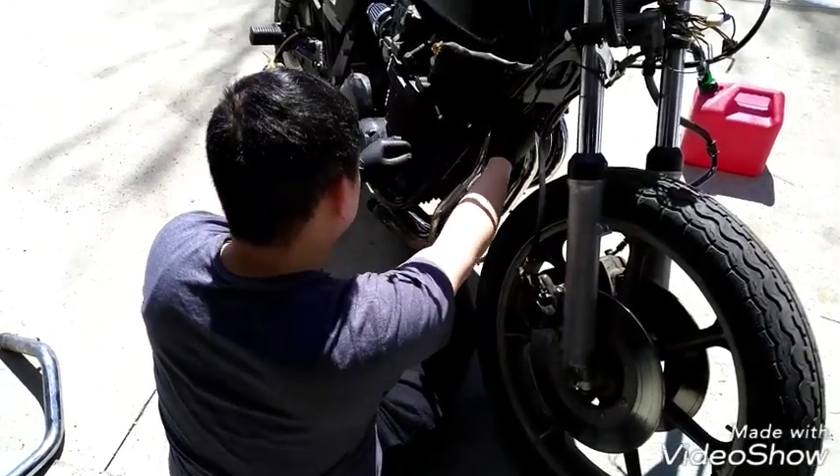Welcome to the channel. Today we are going to the garage to color tune the cafe bike. I don't really know what color tune is, but I saw a video about it. We're going to put in a spark plug that has a glass see-through so you can see the combustion process. If it's white, yellow, or red, that means the fuel-air ratio is off. We're going to tune it so it turns blue, which means it's running at a good ratio.